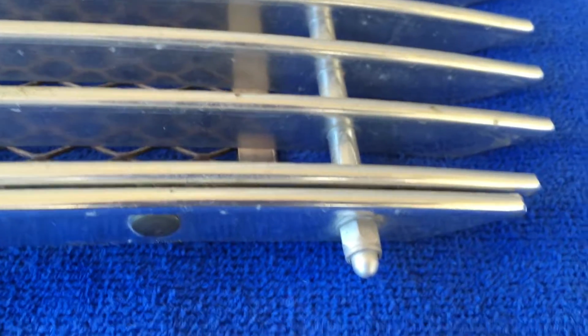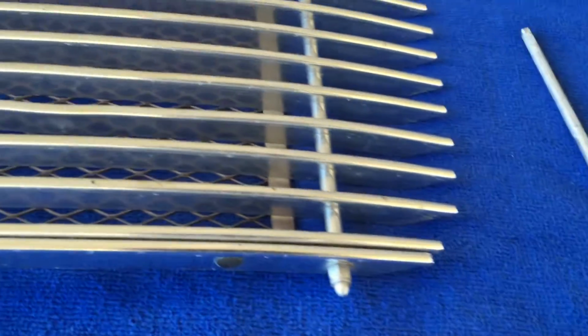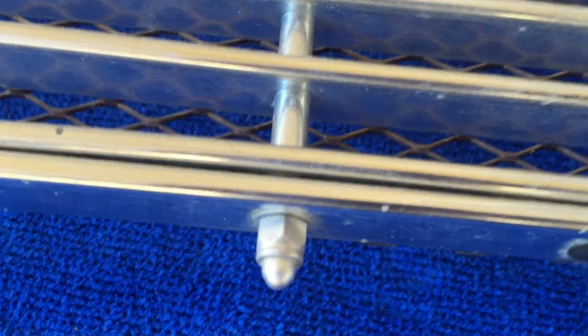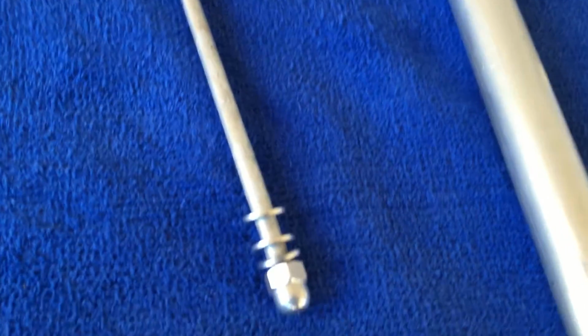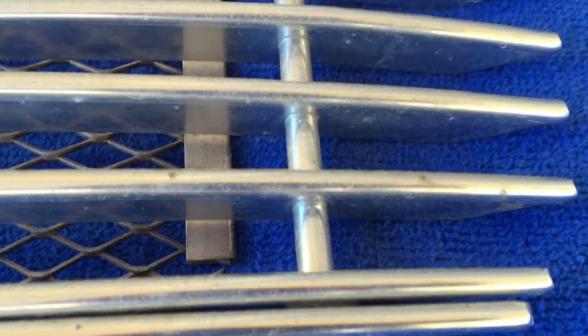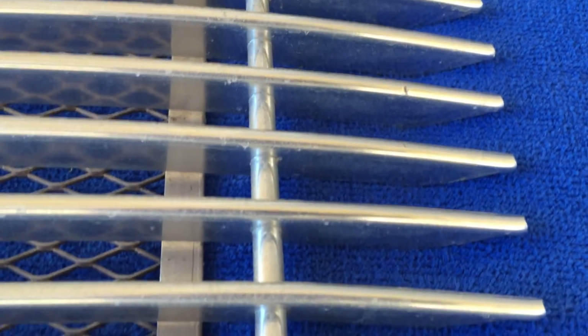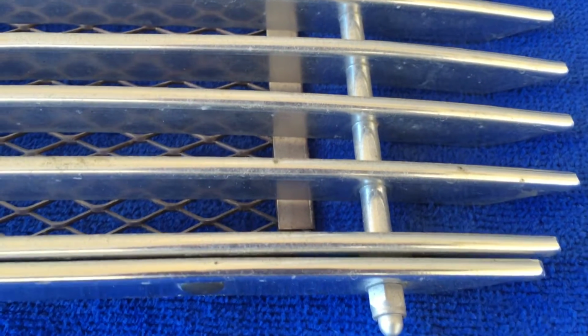But if you still have your original grill, you can take all these little nuts off, pull your threaded piece out, and switch it out and put it on the new grill, and that's going to give you the clearance you need. So hopefully you still got these nuts. If you don't, then you need to do some shopping. Maybe find some small all thread. You're probably not going to find the aluminum shafts. And find a smaller acorn nut to tie all these together. This is not one piece running through here. This is several pieces stacked up with a rod running through the center. So anyways, that's some of the problems you can run into.